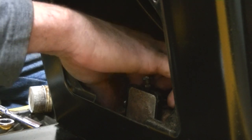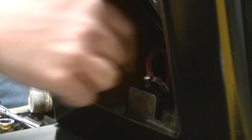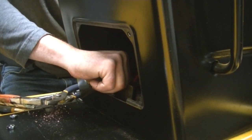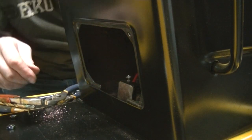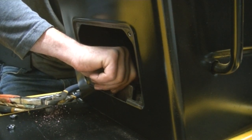This little cavity is pretty awkward to film in. What I did is I sanded down the spot where the relay mounts to the bottom plate in there, and I sanded down the mounting plate on the relay, giving myself some nice clean contact area. I applied a coat of dielectric grease to the area just to provide a little additional protection. Now I'm reconnecting the high-current leads to the starter relay. It does not matter which lead goes on which side — the one for the battery and the one going to the starter can go on either side of the relay. The relay is blind to which side is which; it absolutely does not matter.